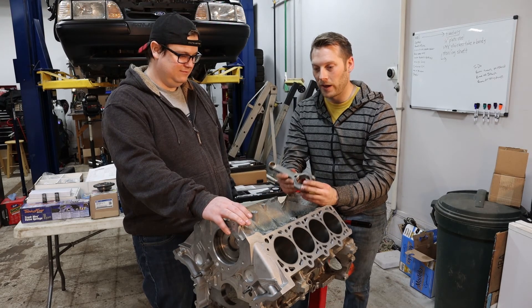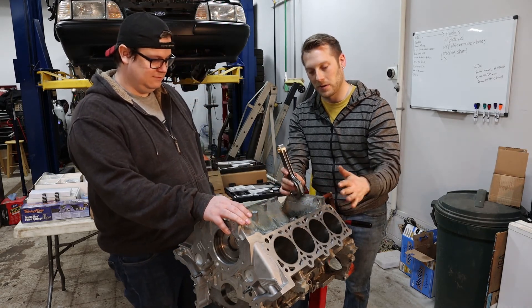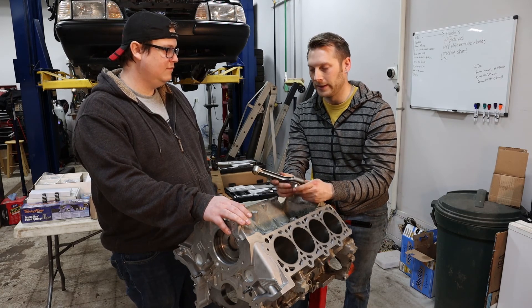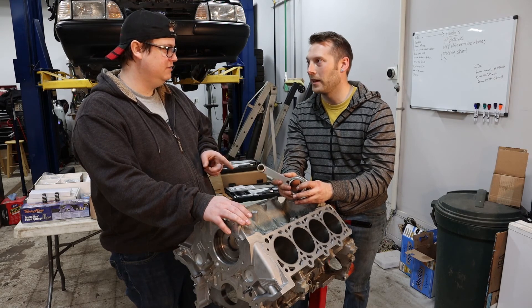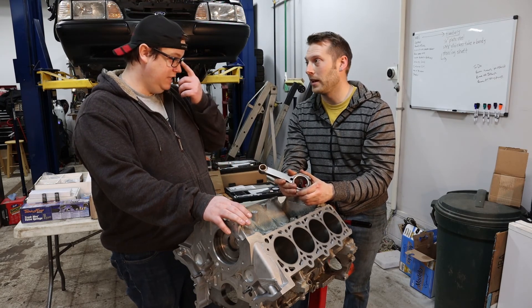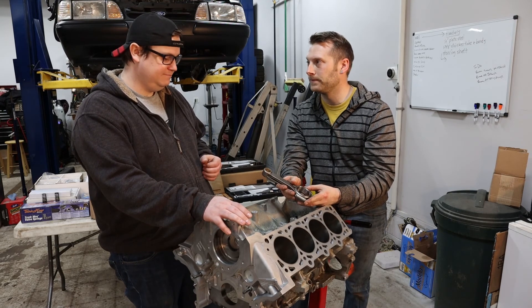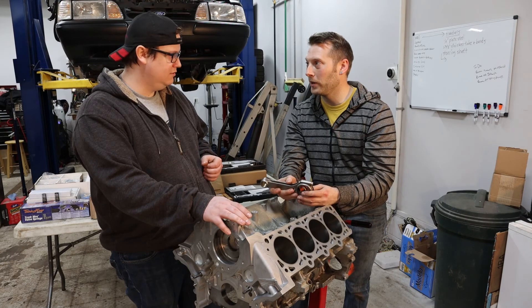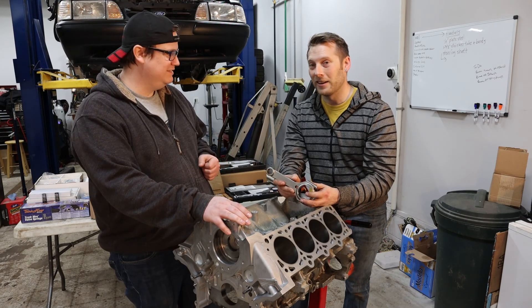This comes back to finding a good machinist, because you wouldn't be able to figure out all the tolerances to make your deck height work without someone who knows what they're doing. And no matter how good they are, verify their dimensions. People make mistakes, and a good machinist will own up to it and fix it. So that's where we're at — crank should be back in two or three days. We'll see you soon.